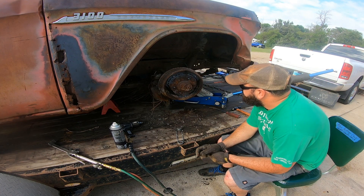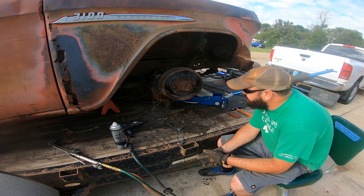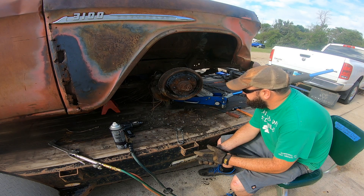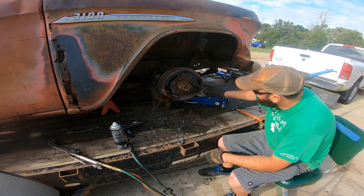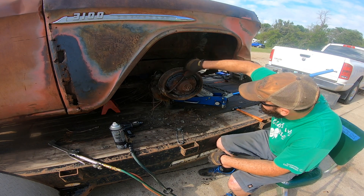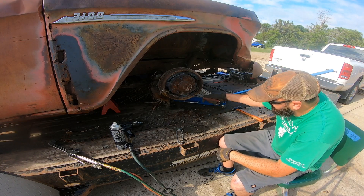I just did kind of one big cut around there — made it wide — we'll see if it just wiggles. Just a little wiggle will give us a glimmer of hope, because I'm guessing those ball bearings in there — not roller bearings, your caged ball bearings that are pretty expensive — I'm betting those are seized up. Good to go — she turns! So instead of making two cuts, you could make one wide cut if you can get it in the perfect spot, but I'm not perfect.